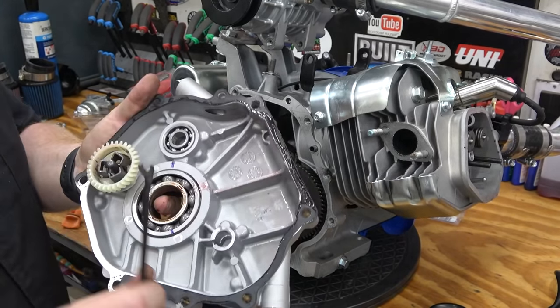And then the arm, just simply rotate the crank over till we can get this arm out, slide it out, and then we need to drill and tap that. So we're probably going to have to pull the entire supercharger off of this engine here.